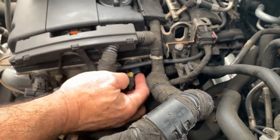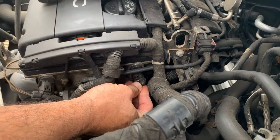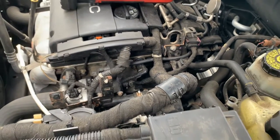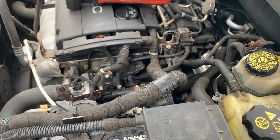So last thing — we got this installed. Take that and push it in and you hear a click. Last thing we do is push this over so it locks it. And that's all it takes to put an intake cam positioning sensor on a 2011 Chevy Cruze with a 1.8 motor.